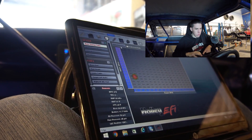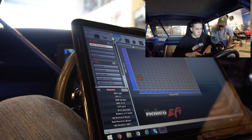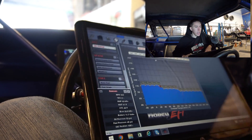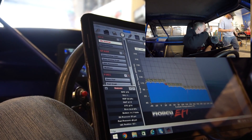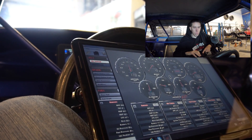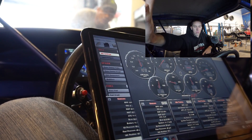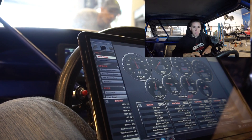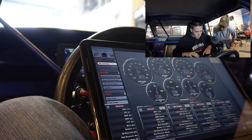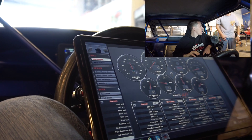Get the idle up a little bit. You need to open up the blades on the throttle body just a little bit. Okay - 1100 RPM, it's a little rich, but that's fine. Yeah, you can smell it over there. It smells like methanol though. More than methanol - but there's still something.